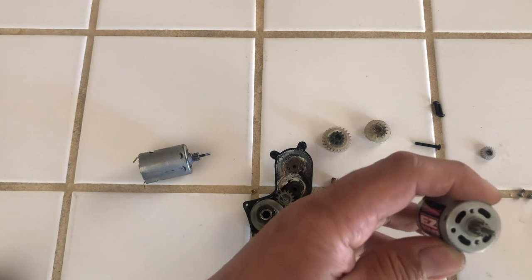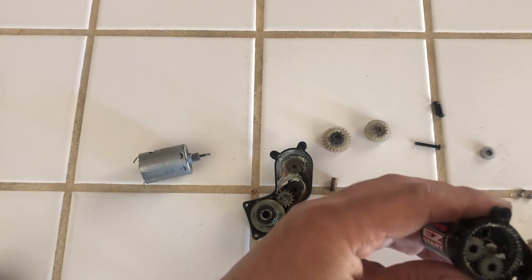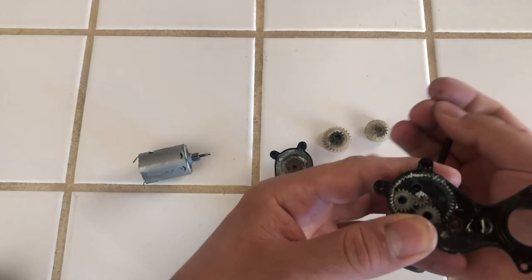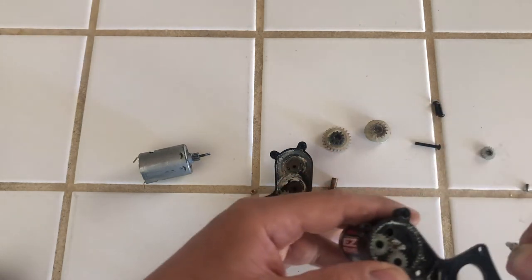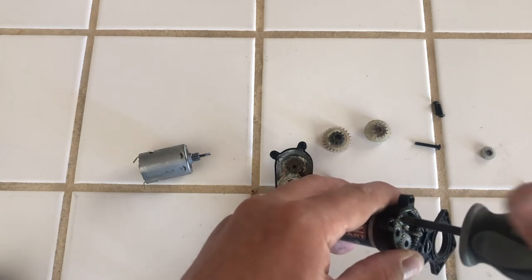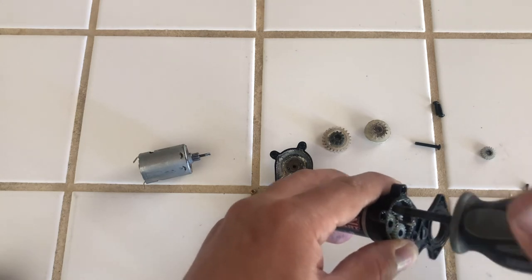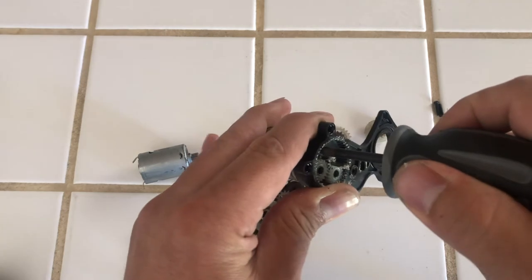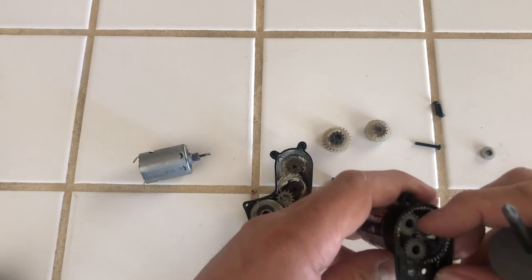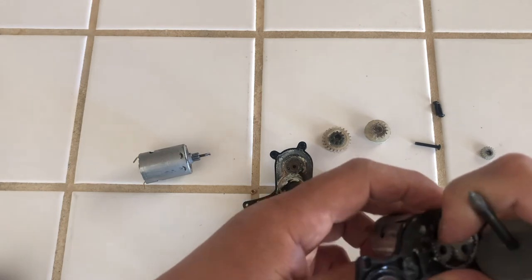And the holes, these are the two holes that you need to line up to set the screw. Now at this point, I'm gonna go through and clean everything off camera, but you may want to put some thread lock on your screws so that they do not back out, hit the gears, and then next thing you know, the gears are hitting that screw, and that's the reason why your pull start is not working. Keep that in mind. I'll tighten this later. Get the gears out of the way so I can fit the screw in.